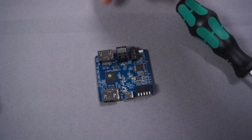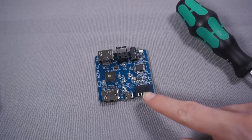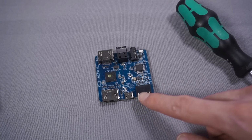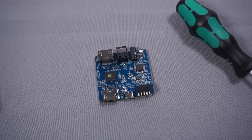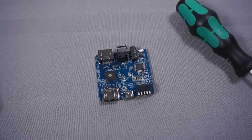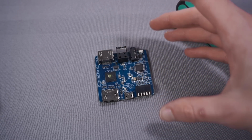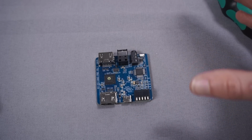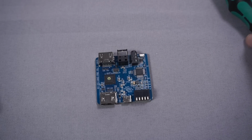What I did is I tried putting a 4K HDR source out my receiver into it, and then plugged my cheap little projector into the output and scaled it down to 1080p, and the projector wouldn't get a signal. So I suspect that was because of the HDR output setting, so maybe it won't downscale HDR, or maybe it will. It's maybe one of those things that you just have to be lucky with. But yeah, that's a little chip there.